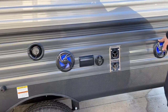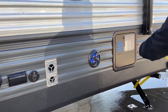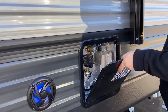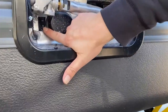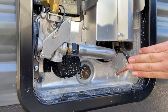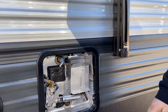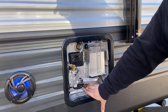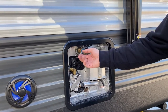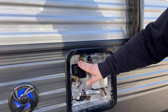Your external speakers are connected to your inside stereo system, so you can run the sound inside, outside, or both. There's your water heater — it is electric as well as propane. The propane is direct spark ignition, so you never have to light a pilot light. There's your anode rod, which will have to be replaced every one to two years. This is the pressure relief for the tank — whenever you go to remove the rod, relieve the pressure off the tank first.